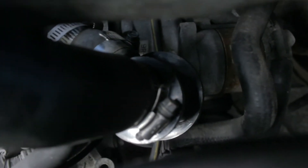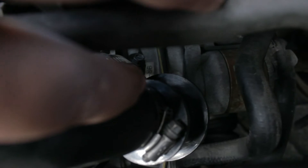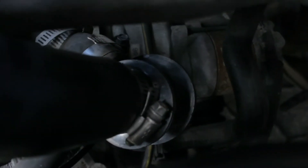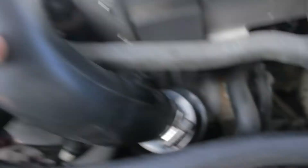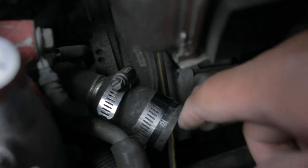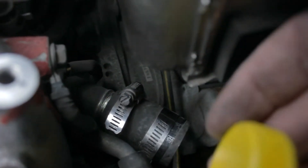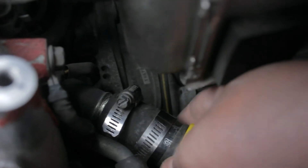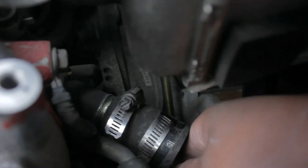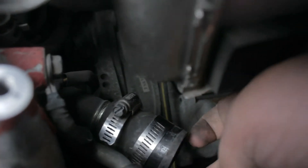There's a little pipe right there going back into the engine, so we have to block that with bottle caps or some sort of PVC. It's just under there — you'll have to get your screwdriver in there and fiddle around with it a little bit. This is the factory recirculating valve. So this is where the recirculating blow valve was sitting and this pipe goes back into the engine. You can undo the hose clamps and pull this off to do the work away from the engine so you don't drop anything.